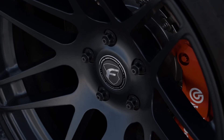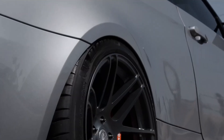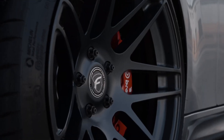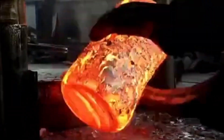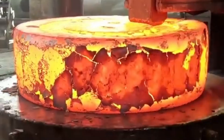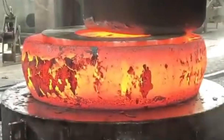Cast wheels are great for your daily driver or a car that sees track use here and there. On the other end of things, you have forged wheels. These involve starting with billet aluminum, then compressing it down with tons and tons of heat and pressure to improve the grain structure — all the little microscopic particles of metal — to make them essentially sit closer to each other and reduce pockets of air. Cast wheels are inexpensive, less durable, and heavy. Forged wheels are light, strong, and expensive.